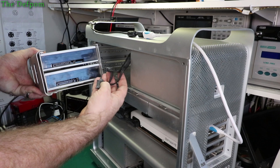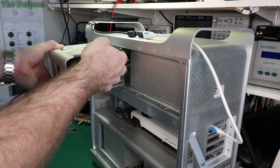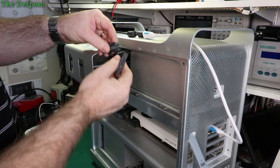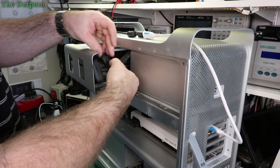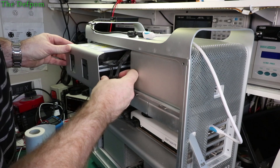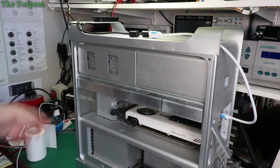Now we've got to slide the caddy in and try and plug these cables in. It's got these little feet — little lumps here — that are actually slotted underneath, and they key into slots on here, which is what holds it in place. So you've got to make sure you line up to those. So that's actually in those slots now — I can plug them in. When you've got these looms you have to be careful about making sure you plug it in the right way around, because the drive doesn't know which one's which — it's based on the cable. The drive you plug the cable into will be the primary cable, so the eject button on the keyboard will eject the top tray. If you hold Option and hit eject, then it will eject the bottom tray — that's a little tip for you. I believe A is the top tray and B is the bottom tray. If it's back to front, you just have to swap these cables around. Slide that back in — and that's it, done.